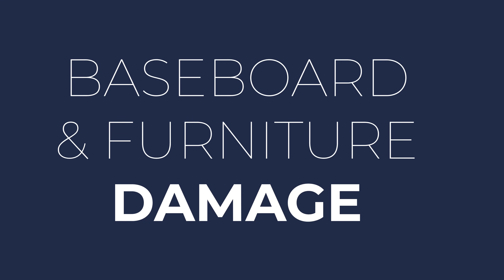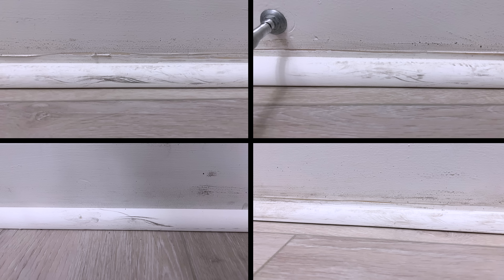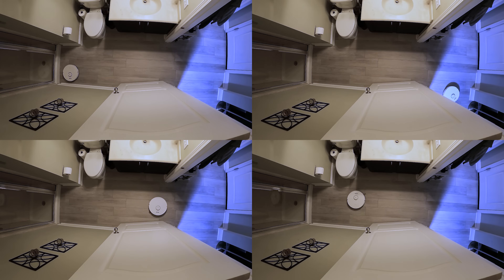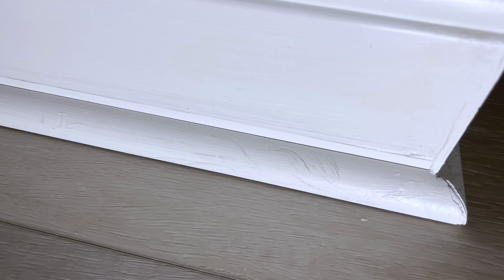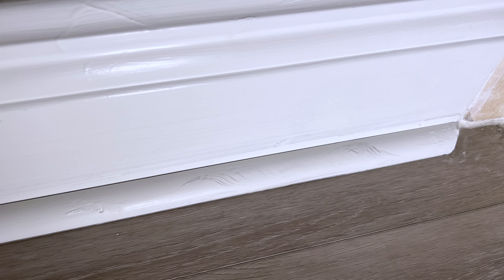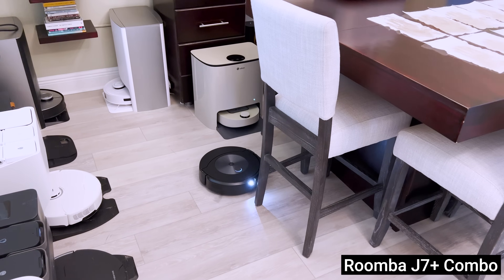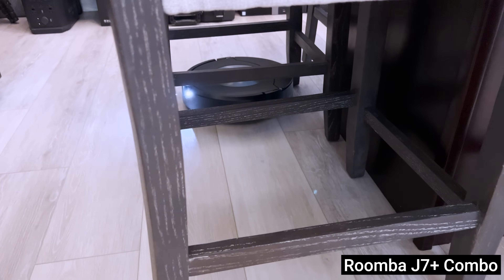One thing that I noticed after a year of having two robotic vacuums cleaning every night was that my baseboards were getting pretty beat up. Specifically, there was a common swirling pattern that I could see all around the house, but I couldn't figure out which robot was responsible. To test this, I repainted the baseboards in my bathroom and had each robot clean a total of 10 times in that confined space where it was likely to get stuck and run into the walls. I found the culprit which appeared to be the side brushes on the Roborock robots. Both the Roborock S7 Max-V and Roborock S8 left small swirl patterns in my quarter round, which wiped off easily, but if not dealt with immediately could build up with frequent cleanings leading to dirty-looking baseboards that needed to be repainted. The Roomba was by far the clumsiest and frequently rammed into walls and furniture, but it must have a specifically designed front section to handle those frequent crashes because I never saw any scuff marks or damage as a result.